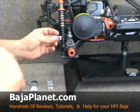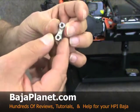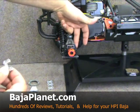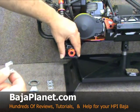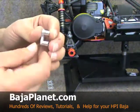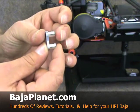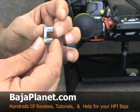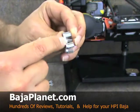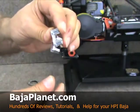The first product is what they call a carrier link. Basically it's a solid link piece, and there are two of them. They're going to replace the nuts that hold the carrier on from the back side. One issue over time is that with repetitive movement back here, the carrier can crack where the nuts go in. This extends the surface area of the nuts to the full size of the plastic inside. There are two per side for a total of four nuts, and they have a link across the back to connect the two together, adding stability in the rear and keeping them together so they're not as easy to lose.